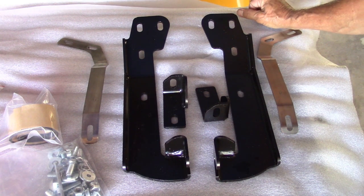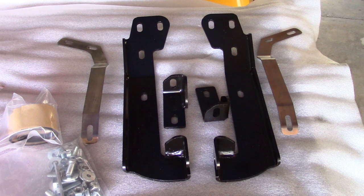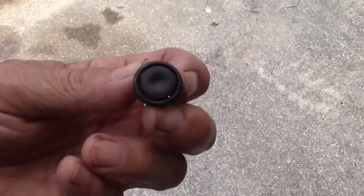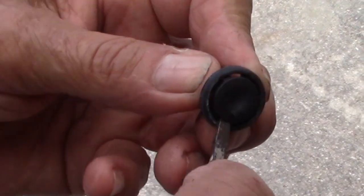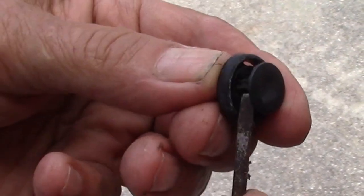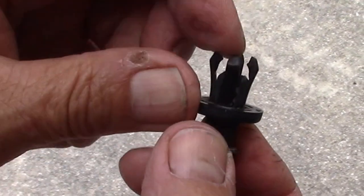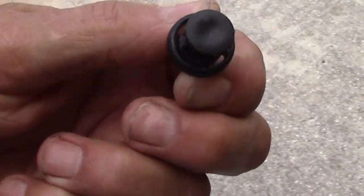Stamping with driver and passenger makes much more sense. The first thing we want to do is remove the splash guards. They are held on with these buttons, and to remove them you take a small screwdriver, insert it inside or underneath that clip, pry it back, and pull until it's fully extended. That allows the expansion part to release and then you can pull your splash guard off.